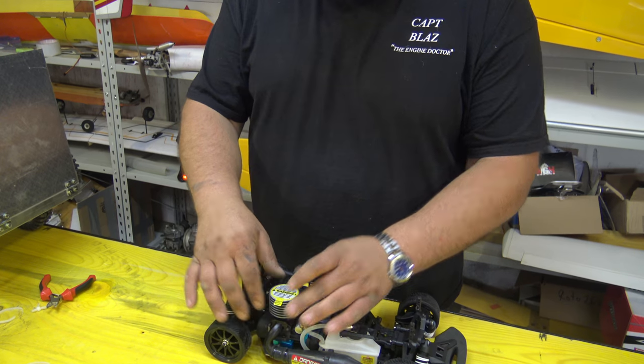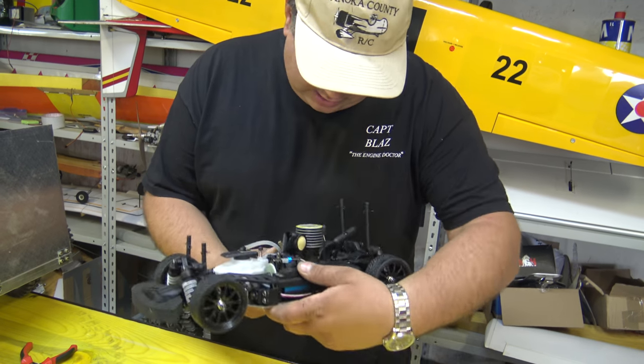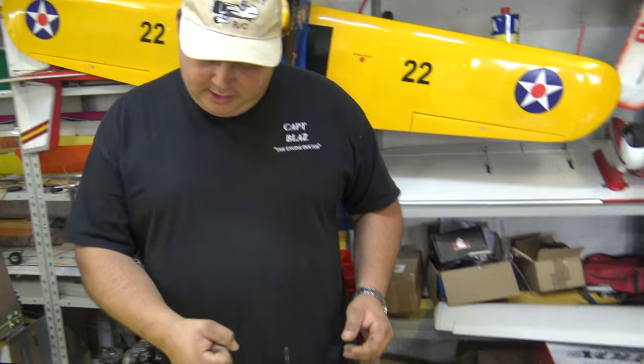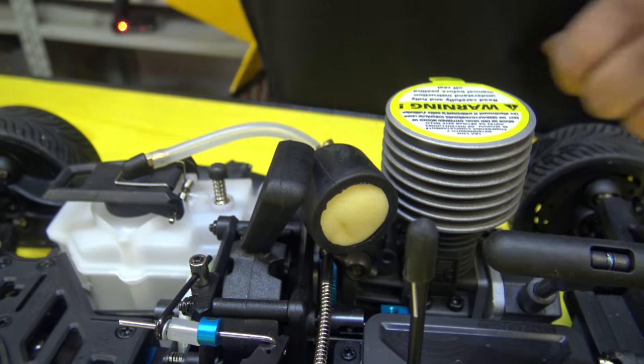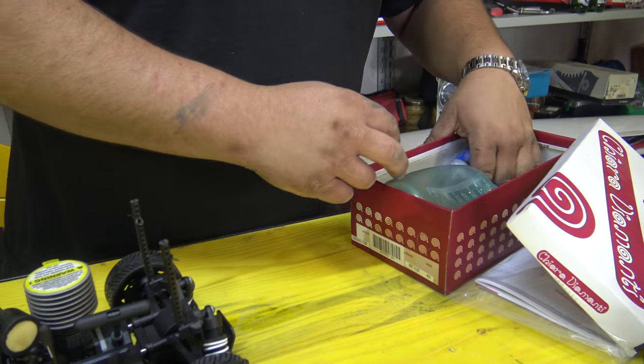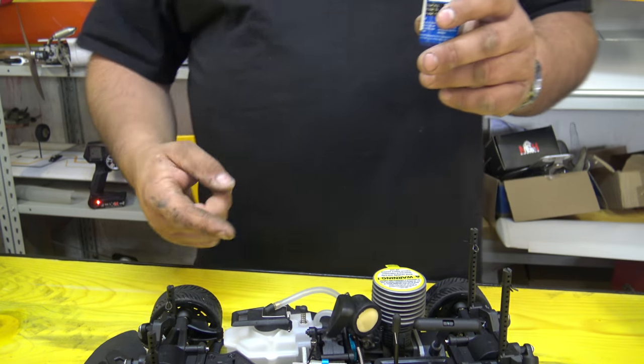So the cylinder slightly expands. Because this engine doesn't use piston rings - it is made so it pinches on the top. If you warm the cylinder a bit, the cylinder expands so you can easily start it for the first time, so it doesn't hurt the cylinder. You warm it with a heat gun. And there's an air filter - so it doesn't pollute. You must use air filter oil: you oil up the filter so it doesn't suck in debris and hurt the engine.